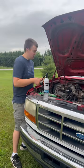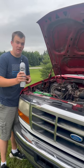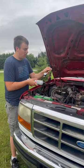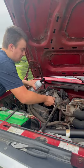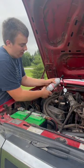The first thing you want to do is start up the truck and then turn the AC to max AC. Now what I'm going to do is move the cap for the AC reservoir, shake the can a little bit. Then you'll install the hose to the reservoir and shake it between the 12 and 3 o'clock position while you hold it down and watch the gauge.